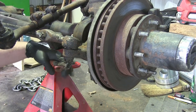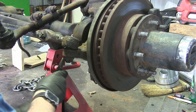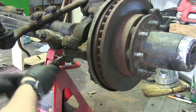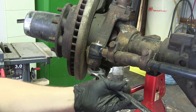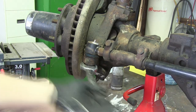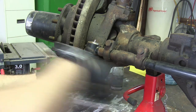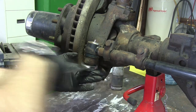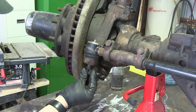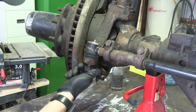First thing we're going to do is get the drag link, tie rod, and steering stabilizer out of the way. If you're having trouble getting your cotter pin out, try pulling it out with a set of side cutters or dykes — really makes it easy. It's an inch and a sixteenth on this castle nut. If you're going to hammer out your tie rod ends, take that castle nut, flip it upside down, and screw it back on the tie rod so when you go to knock it out you don't damage your threads.